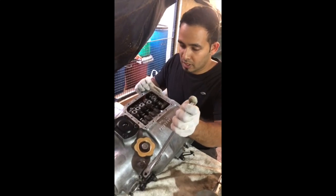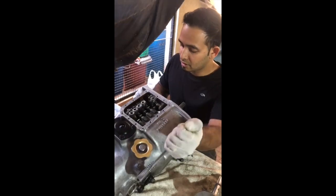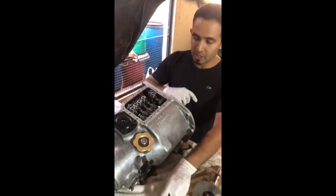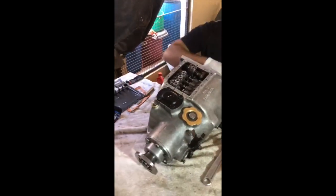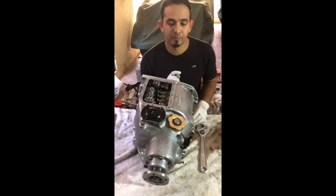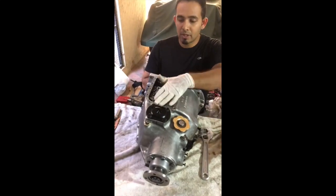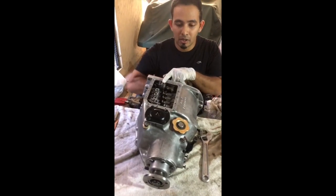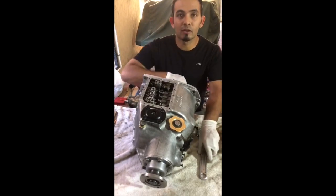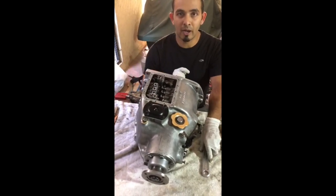I'm going to go into top gear — watch here. As soon as I do that, you can see the third gear is disengaged and the fourth gear is engaged, and that's the final drive output. As I'm turning this you can see it's moving at the same speed, which is basically top gear. I can also show you reverse — I'm going to shift it all the way back into reverse but nothing has happened; it's still on top gear and still driving. You can see the shaft is still moving at the same speed as top gear, so I'm in reverse now but still using top gear.